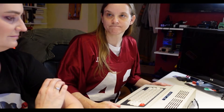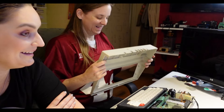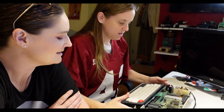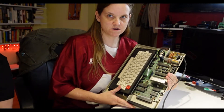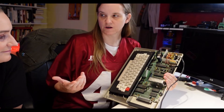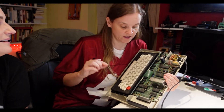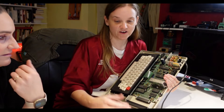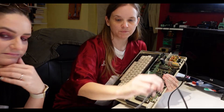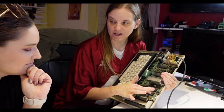I love it when it's easy — so here's the inside of the TRS-80 Color Computer 2. TRS-80 was named for the Zilog Z80 processor, which the Color Computer does not use — it uses a Motorola 6809. So it's just a grandfathered name. And this is unplugged. That's where the extended RAM would go if we had it.